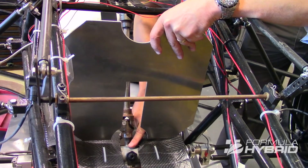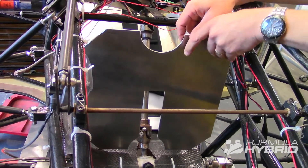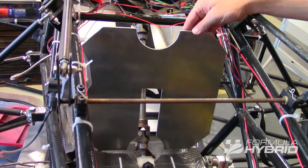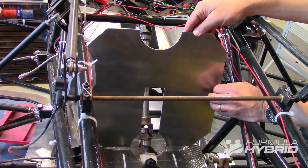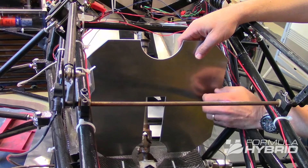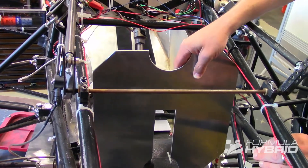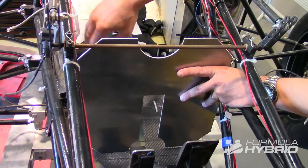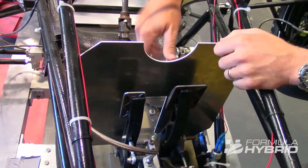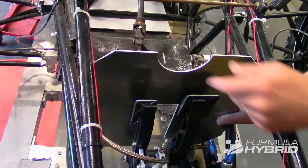Many of you will have a steering rack under the driver's legs. Note that for the horizontal template in the seat area, it's very specific that the template may not move fore or aft. For this vertical template, we have not written that rule, so there is a little bit of wiggle room for it to go up and down — but that is at the discretion of the inspectors, and they may decide it must go purely forward. The template is then continued forward, and any time it cannot pass a certain structure, that would be a potential fail. It passes all the way to the point where it reaches the pedal package. As the rule is written, it must be four inches maximum from the pedal package when it stops, and in this particular vehicle it reaches almost all the way.